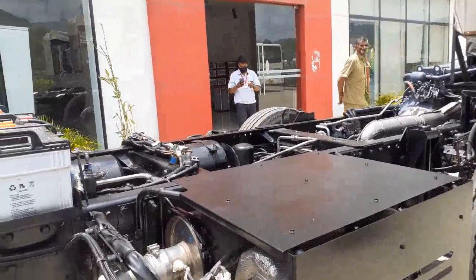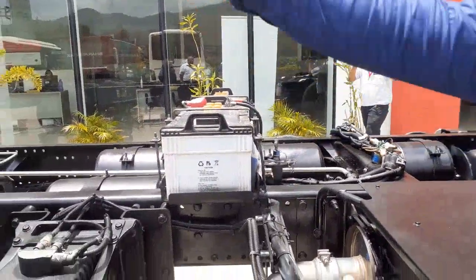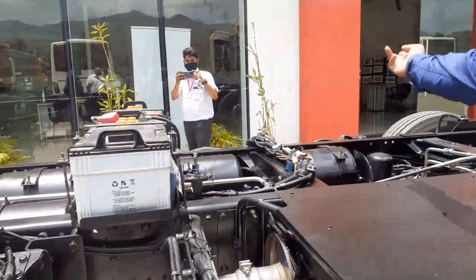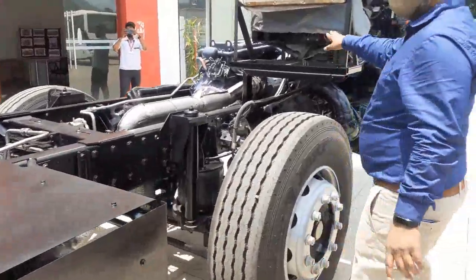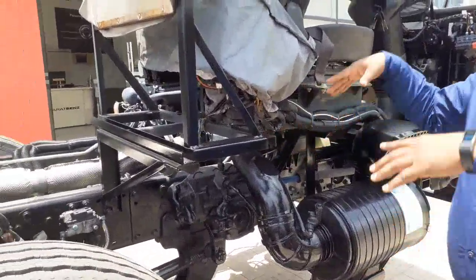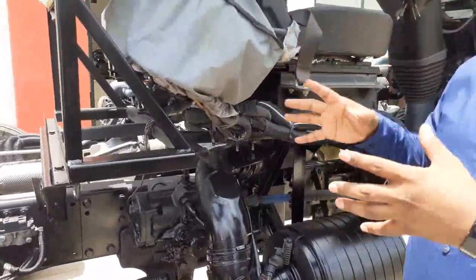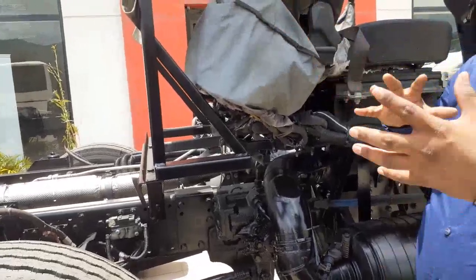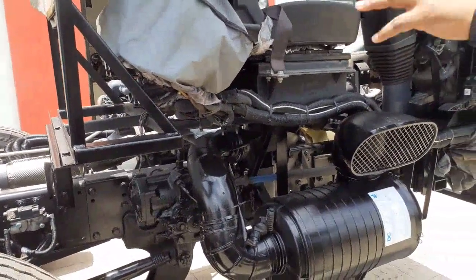If you want to change the location of the batteries and spare tire, that is possible — the battery and tire positions are temporary. When they are moved, you can see there are extra cables which get mounted on that side, and the tire goes into the body space. This is also a temporary member just for the driver seat — once you build the body, the driver seat and everything go onto the bus body frame. The electronic unit box contains all ECUs, fuse box, relays — everything is packed in one secure, centralized box so you don't have to find individual components.